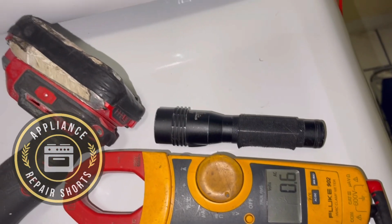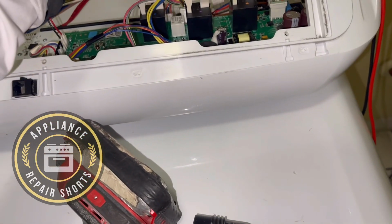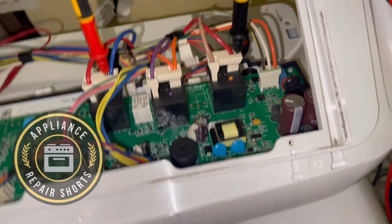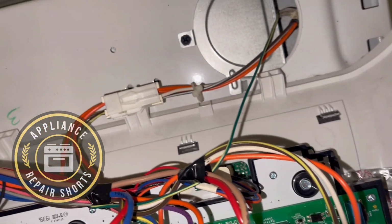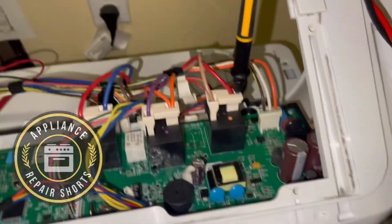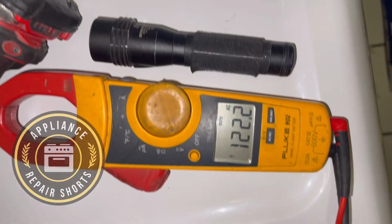I have other videos on how to get inside of a GE. So, pretty straightforward. You do have the 2 1/4 screws on the back. Push the back panel backwards. Then you have 2 Phillips screws. Remove those. Open the door in the front. Look up, under. And you're going to have 2 more Phillips screws. Then you just slide the top back.